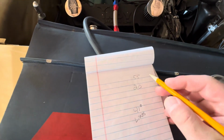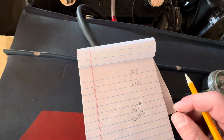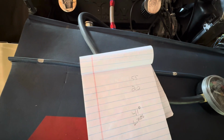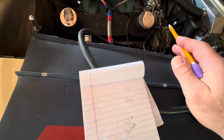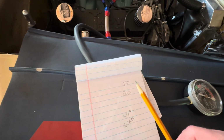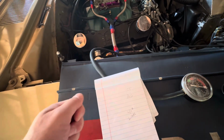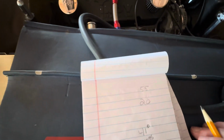Now the other thing I learned was the vacuum pod seems to always give me 20 degrees. And it's right at idle. Right when you plug it in, it goes to 20 degrees. So I hooked the Mighty Vac up to it and learned you could adjust how quick it came in. And you seem to keep pumping on it and it would come up to like 16 and it would stop. But the way this works in practice and not theory is once you get vacuum on it, it goes right to 20. I don't know exactly if that 10 inches of vacuum keeps building on it and it keeps pulling it slowly. Like, it goes right to 20 degrees advance. You could literally watch it by pop it off, put it on, and it would just add 20 degrees. So that's a known factor.